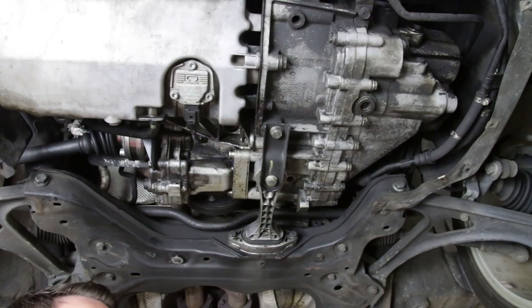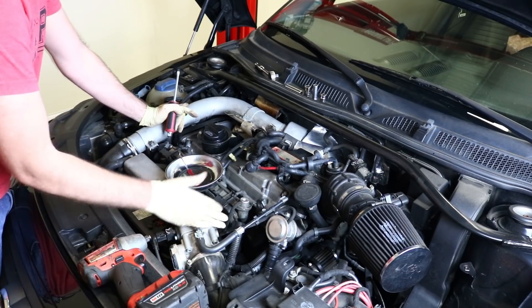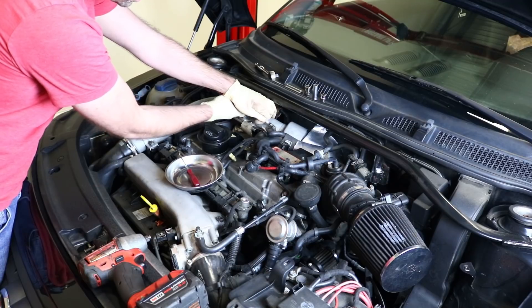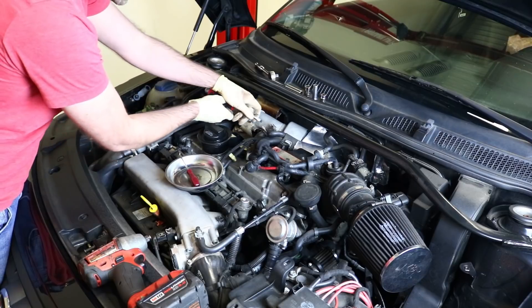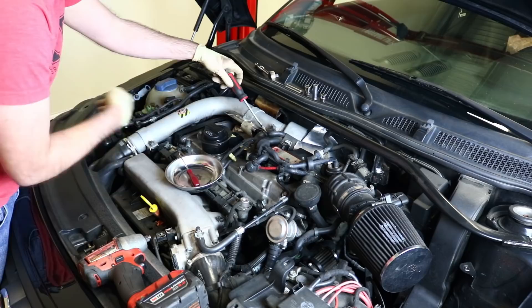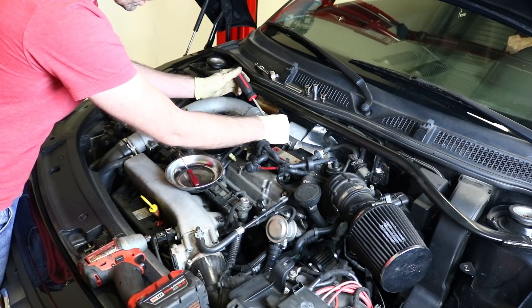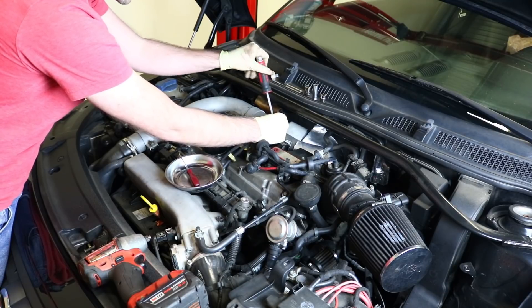We're going to be addressing that and then cleaning it up to make sure that everything is good. This car doesn't have an engine cover as you'd normally see — TTs normally have engine covers all over the place. We're going to start by taking off these hoses right here. You have to get all of this stuff on top of the valve cover out of the way, including this boost pipe here. This runs over to the intercooler — the TTs have two side mount intercoolers for the 225 cars, so it has this crossover pipe you wouldn't see on most transverse 1.8Ts.